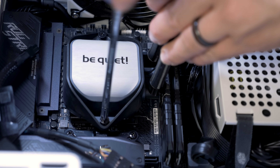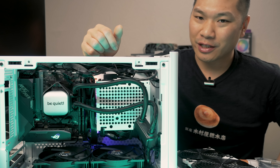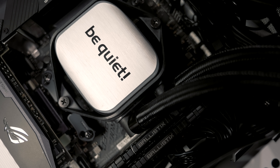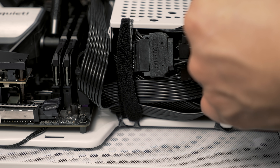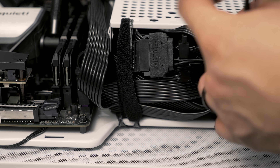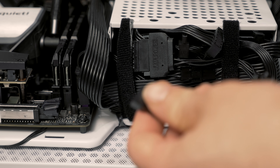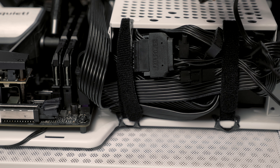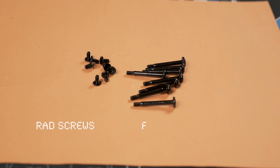It's a little annoying to have to run an extra SATA power cable to the PSU, but this is actually quite common for AIOs. I was able to tuck the LED cable from the CPU block around the RAM and tuck the SATA power cable away really neatly underneath the PSU. You'll also need to connect the pump cable to that SATA power cable since it's a single-speed pump requiring a constant 12V source. The fan screws are long enough to work through a rad panel or a case, and short enough to not damage the fins.